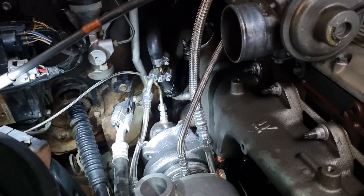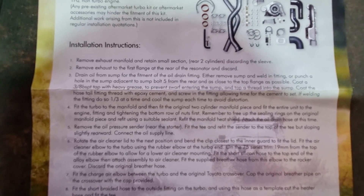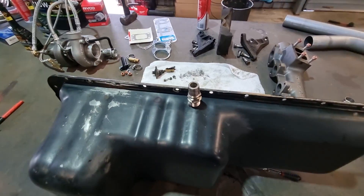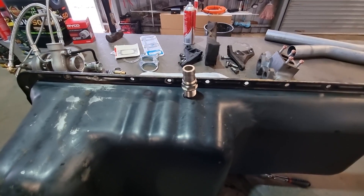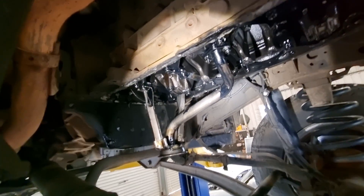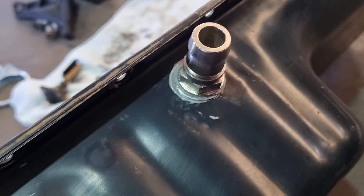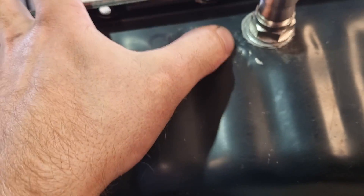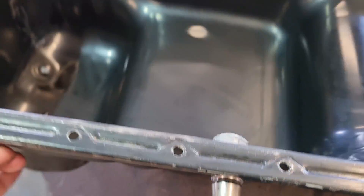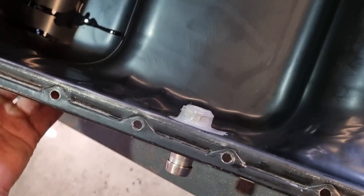Now I've just got to do the oil feed and we're good for some spools. When it's time to install your oil return fitting, the manual says install it right next to the fifth bolt hole. I recommend offsetting it slightly so you can install your sump bolts — I went between the fifth and sixth bolt hole from the rear. That allows me to get directly below the turbo and is much closer to the factory return boss. I bashed the mating surface flat to aid with the seal and gave it a deluxe silicone on the back.